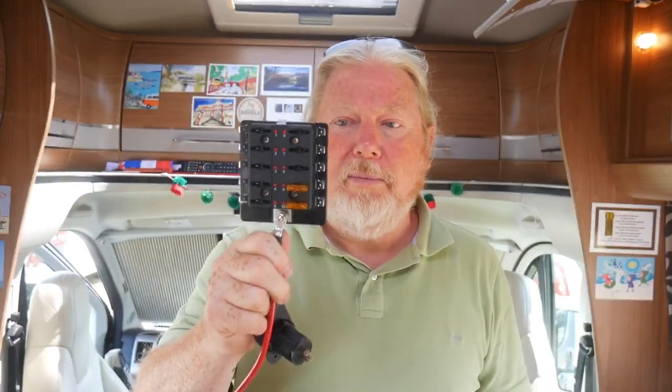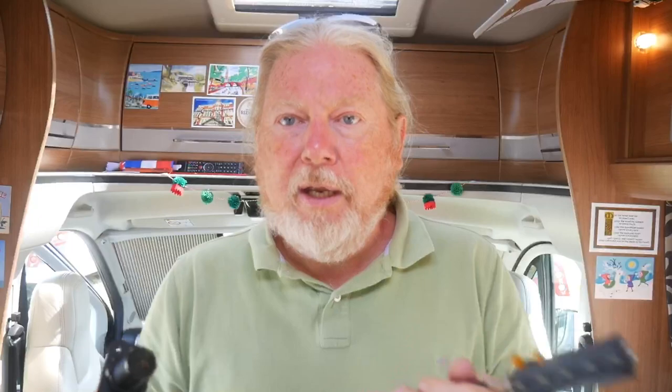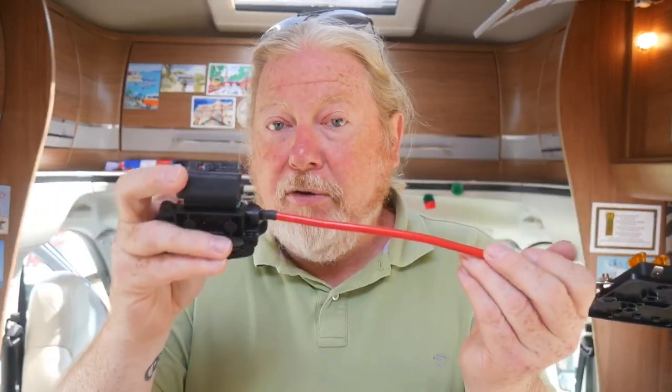It's all pretty simple apart from where to put them. I might well run another one or two of these across to the other side of the lounge — I'll have to run the wire underneath the van, back out from the fuse box and back over, and maybe put in a couple of USB and 12 volt outlets in the outside cupboard. I bought the big fuse box — it's got 10 outlets — so I can wire up 10 of those. As long as I don't go more than 60 amps in total on a continuous or peak draw, it's not going to blow that main fuse.